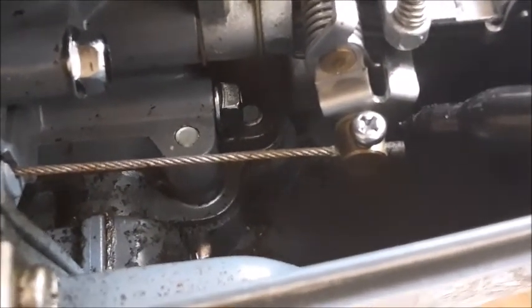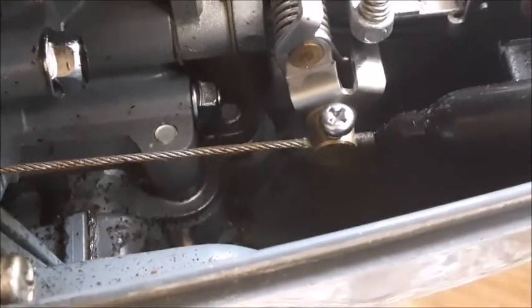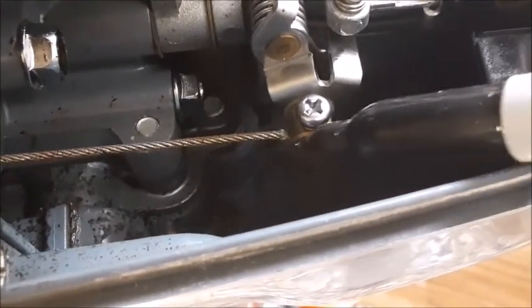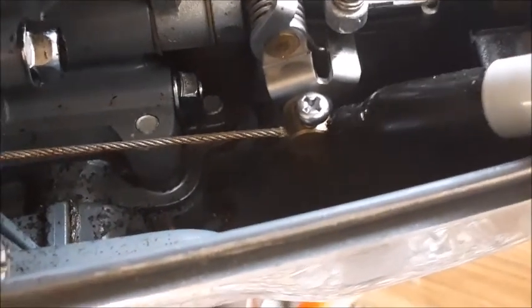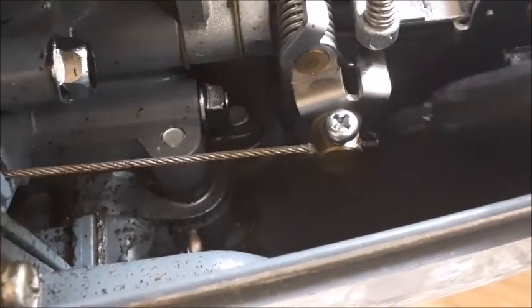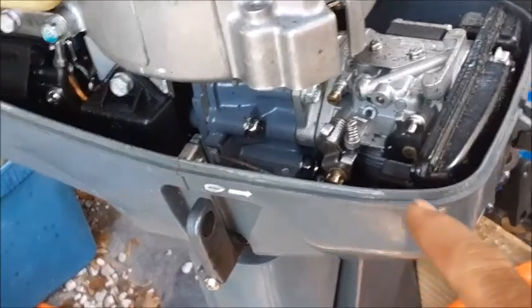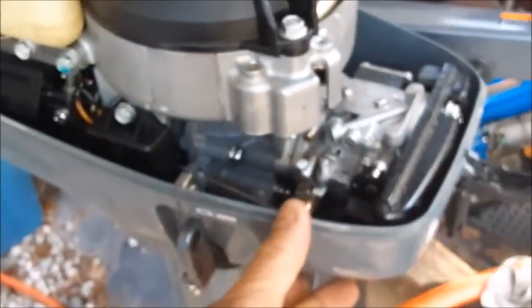You have to take this screw out right here that holds the wire for the carburetor butterfly valve. You want to make sure you get this back into the exact same position as far as where it's clamped down on this cable. So you might even take a Sharpie and mark the tip, and that way when you go to reassemble it you'll be able to line up right to the edge of that mark you made. The actual front of this cowling can now come off. There's a screw back here on both sides and a couple other bolts up underneath here, and once you take those four off this whole front cowling will actually come off and give you good access to the carburetor.